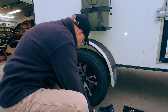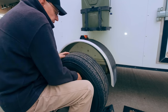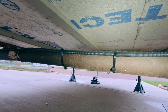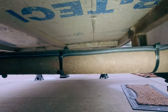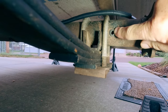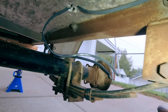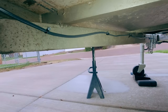It's a dark, foggy morning and I couldn't wait to get started. It poured down rain all day yesterday — record rainfall. Anyway, this is easy. About the hardest thing for installing trailer brakes is just running the wire, and this took me all of about an hour, including wiring the seven-pin plug at the front of the hitch. I decided to run the wire on the outside of the axle and secure it. The other way is to run it inside the axle through the holes, but these axles bounce up and down violently and I didn't want the wire getting flailed around and beaten to death inside. So I ran it on the outside where I could keep an eye on it.